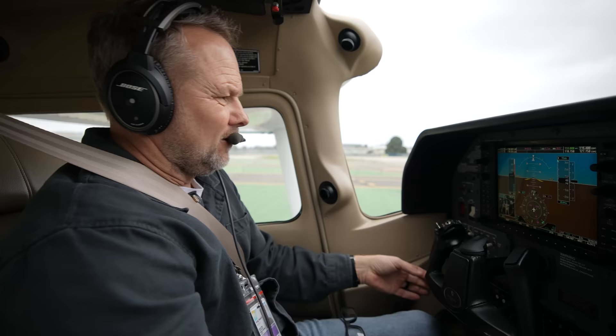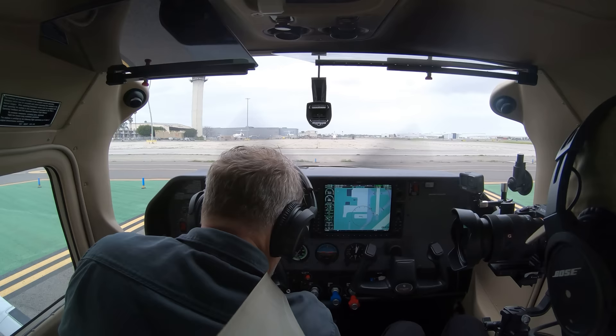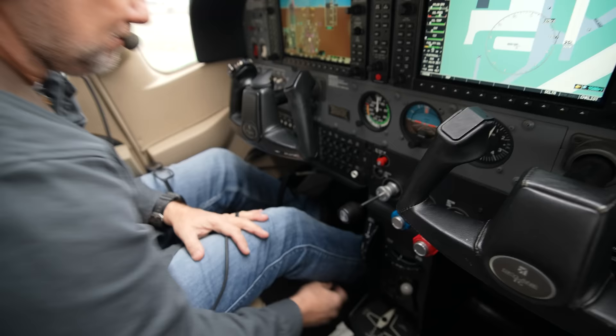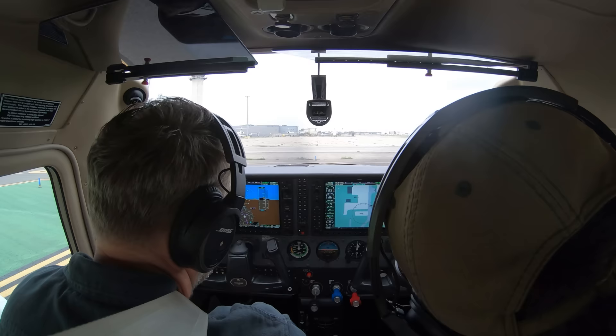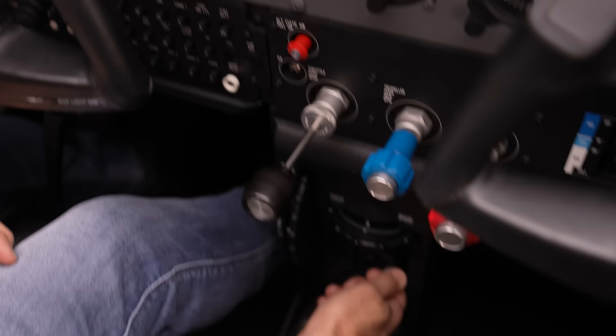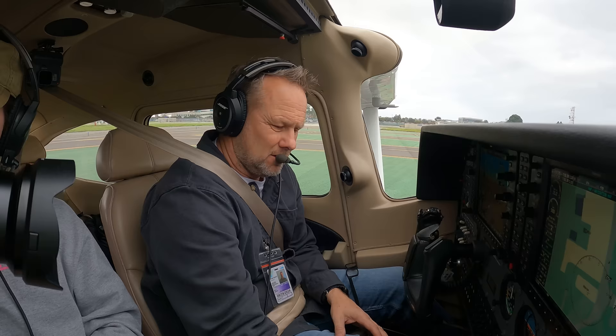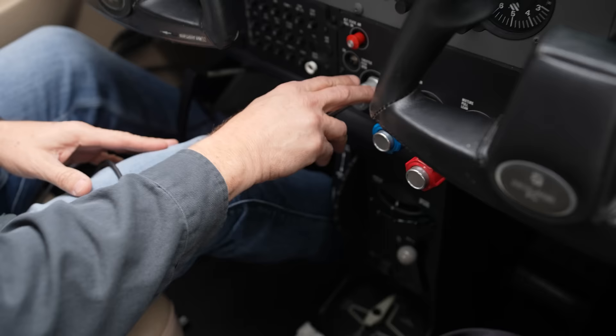This could be a pretty short flight, so we'll get through the run-up. This is again a Turbo 182T 2013. I'll start down here — fuel selectors are on both. While I'm thinking about fuel, I'd like to check the quantity: we got a short flight, about 45 gallons, plenty of fuel, checked it visually. Cowl flaps are open down here. Trim is set on elevator and rudder, flaps are up — I'll use a flaps-up takeoff. Heating is off, propeller is high RPM, throttle is where I want it. Alternate static air — I checked that and I get a little tick there, that's good.